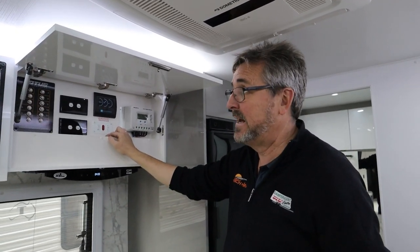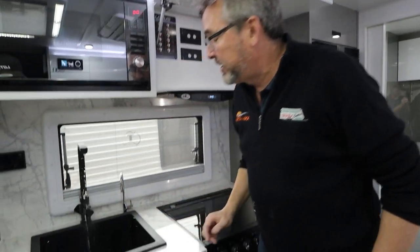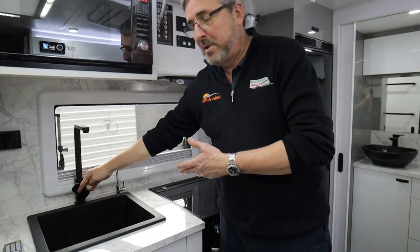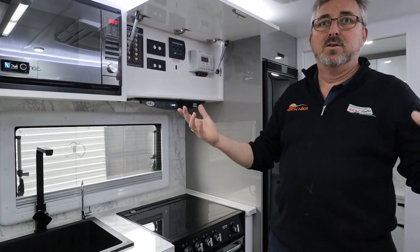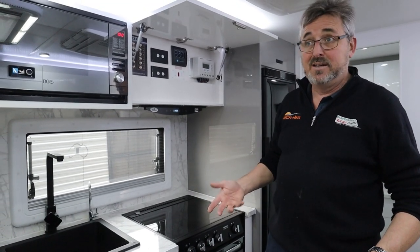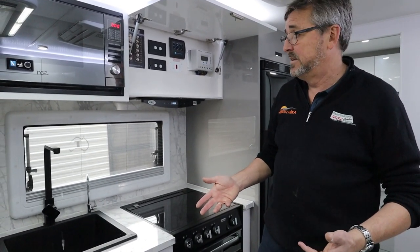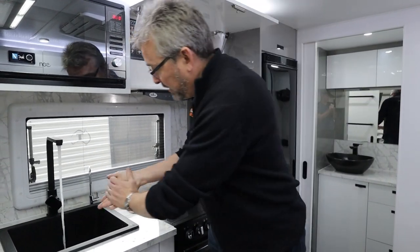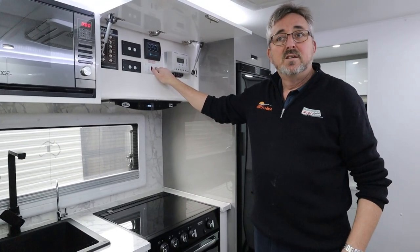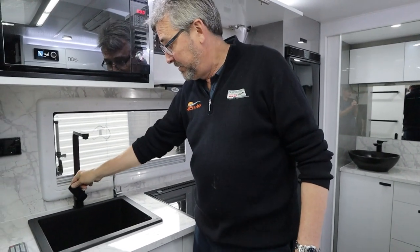What we like you to do when you get in your van - if you're at a caravan park, that tells me you're plugged into 240-volt power because it won't light up if you're not. If you've opened your gas bottle and you know you've got gas, fine. What we want you to do is run your tap. You'll get rid of all that air if you've been bouncing down the road because it's all in your plumbing, and then you'll get water coming out. You want to make sure you've got water in your van - if you've popped a hose on travel or you've hooked up to the caravan park, you may not have turned the tap on. Use it as an excuse to wash your hands - wait for a bit. We've got a good solid water flow. That's when you turn on your hot water tank. Hot's to the left, cold's to the right.